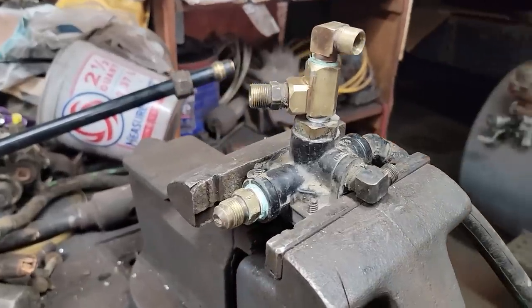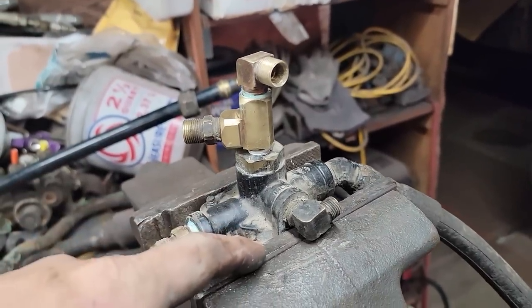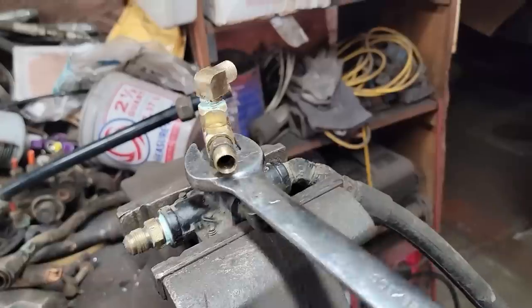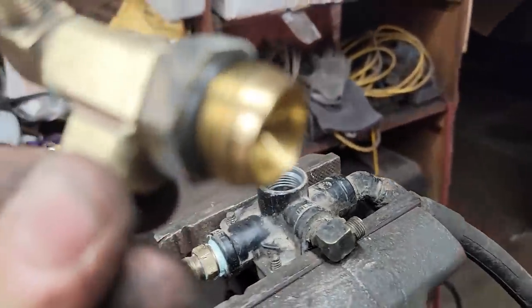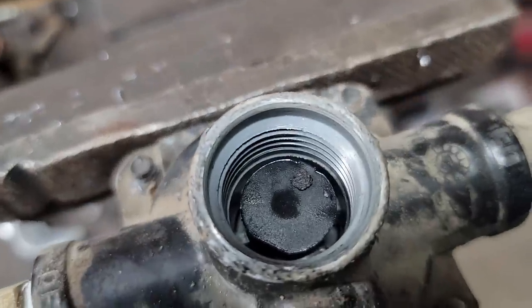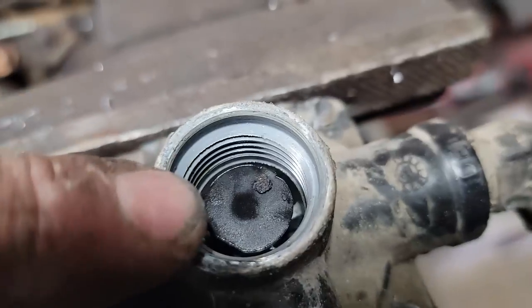All right, I got the quick release valve out. And this is like a modulation line. I think I've explained that before, but there's nothing in the bottom but just a little diaphragm, nothing at all. And then here it's more of the same, diaphragm and a spring. Little orifice. Oh, looky there. Looky there, that's enough to stop it from sealing.